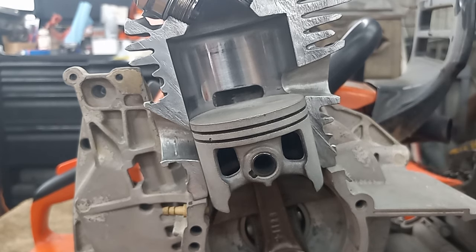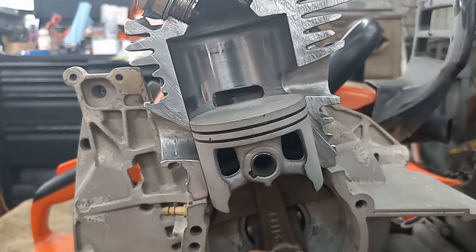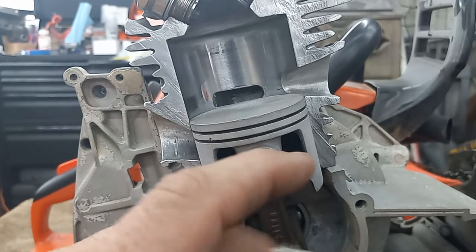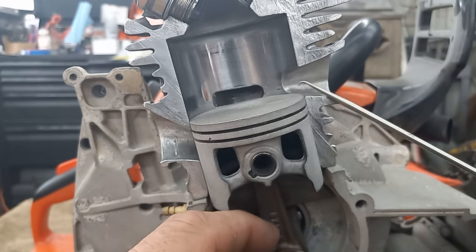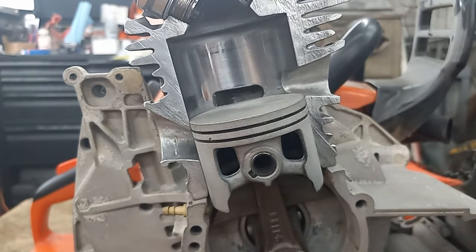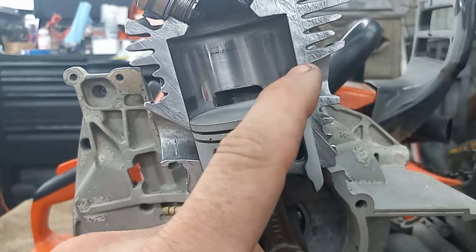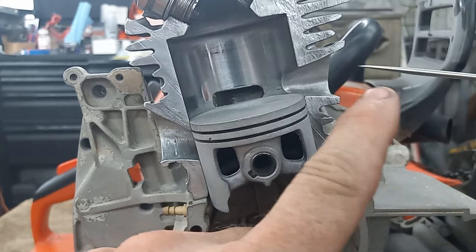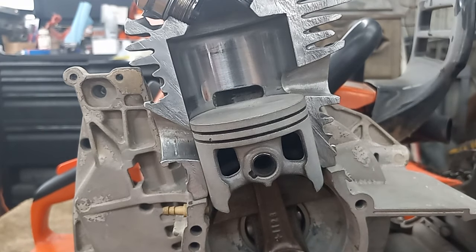It comes with the school of hard knocks and a hit to the pocketbook — really frustrating when you're shooting for the moon and you completely foul it up. You can get little gains here and there and it all adds up, but it only takes one mishap like reversion or too big of an exhaust port. You get too big on your exhaust port and velocity drops — you'll pull less out of your transfers. I'd rather pull a bunch out of there and evacuate as much spent charge into the exhaust as possible. I'm fine with wasting a little good charge — I'm fine with having good charge trapped in there too.